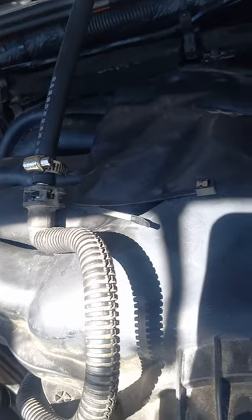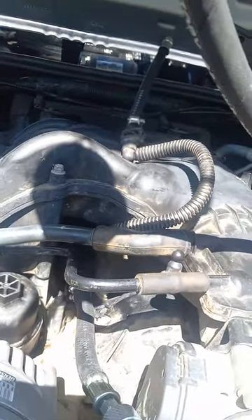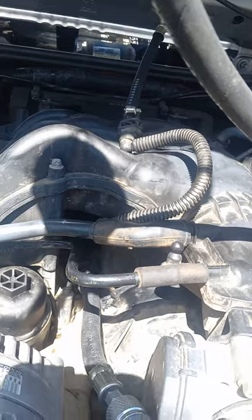All I'm using to hold my fuel line on up here — you can see it's a zip tie. That will hold your fuel line on, so if you break the infamous clip, or it's already broken, you could use a zip tie.